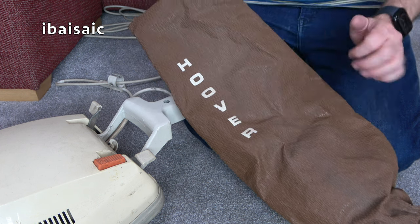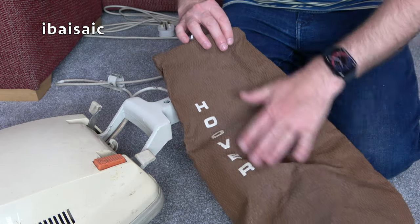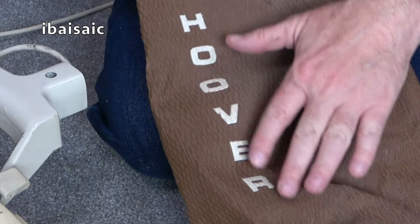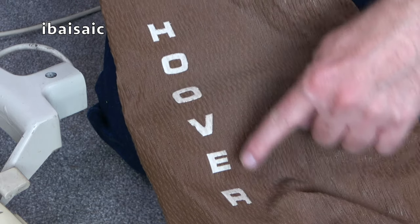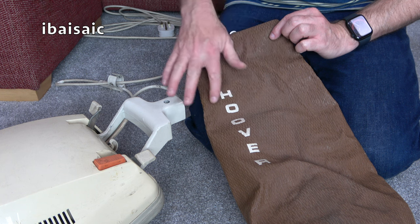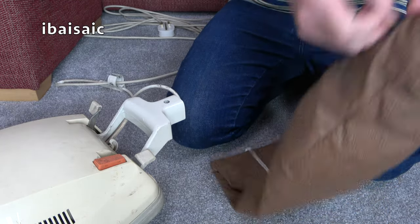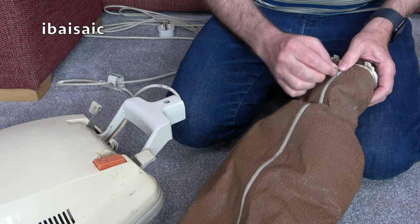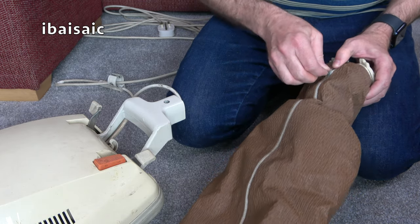With the Hoover lettering. Looking at it, yes, it's in good condition. It will clean up nicely — it's a wipe-clean bag, as Hoover used to call them. It's sort of a plastic fabric, and the Hoover logo will survive a gentle wash. I'd never put this in a washing machine — hand wash only. That will look a lot whiter when it's cleaned. Unlike the round Hoover logos on some soft-bagged juniors and some seniors — put them anywhere near water and you've lost the logo. There is quite a lot of rusting on various parts, and I think this zip could be problematic. You can spray a silicone lubricant — a clear lubricant — to help get the zip to work.